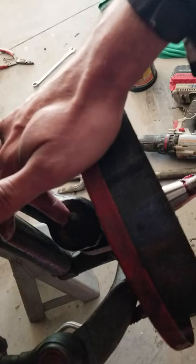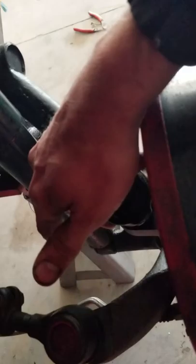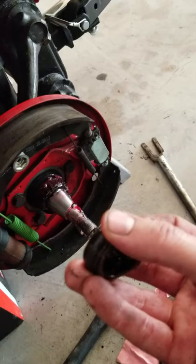Put it back in. I just lifted this arm with a little force, had the bottom one sitting in right here, just kind of put it in loosely, lifted this until it fit in, and then of course do the reverse. You'd already placed the boots. The boots are kind of a nightmare to work on. This is what happens after the pickle fork.